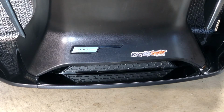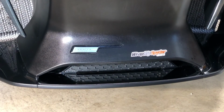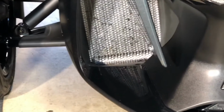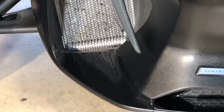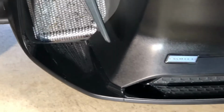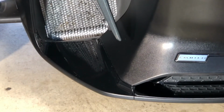And we're going to repeat the same process on that outer panel. One more time. Get you into position so you can see. This video is being shot in real time, so as you can see, it doesn't take a ton of time. But you really have to take your time for surface prep. That is so very important. Making sure the surface is clean, it's ready to accept the product.